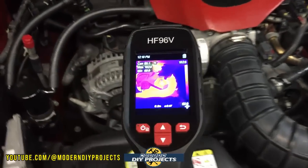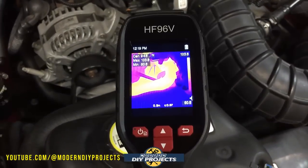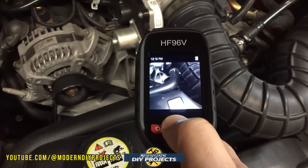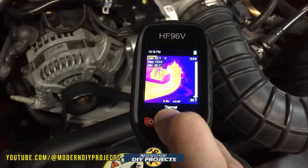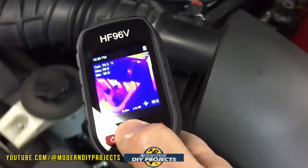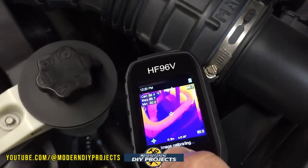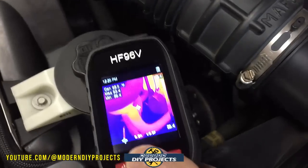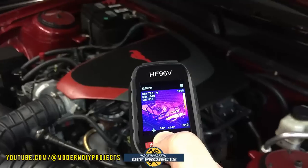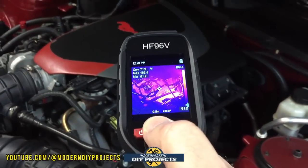You can also check whether coolant is heating up properly and whether the thermostat is kicking on. The upper water hose is heating up nicely even after just a brief run. The lower hose is cooler because I didn't run the engine long enough for coolant to return and warm it — you can see that difference clearly. Switching to regular visual mode shows almost nothing, but thermal mode reveals everything going on in the engine.